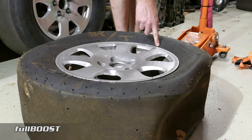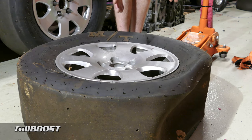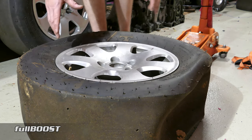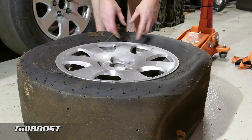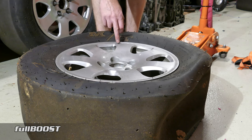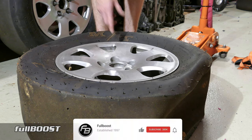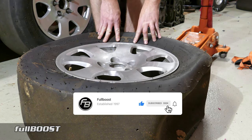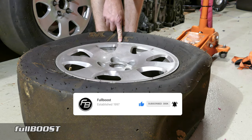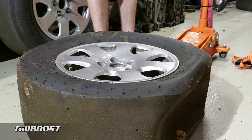The much more difficult part of this is that we have to remove the tyre from the rim. First, we have to get the bead away. The wheel essentially has a bead, which is a slightly bigger impression around the edge that the lip of the tyre pops off around. When you're actually trying to get a tyre off the rim, you've got to get it off this little bead area first, which is really difficult, so you're going to need some help.